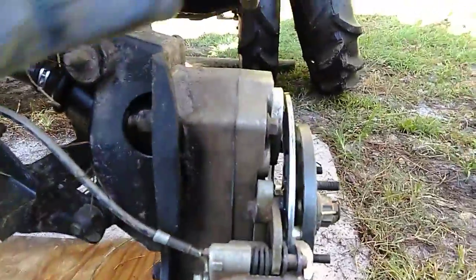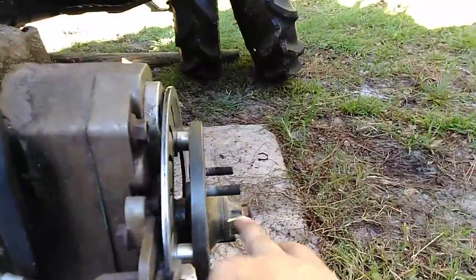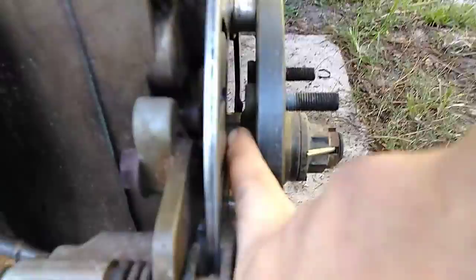The Gen 2 gives you a new front cover, it gives you a new hub, it gives you a bigger shaft. They even say in the Gen 2 ad, a bigger cotter pin. Oh, why would you need a bigger cotter pin? Maybe because they're designed wrong, the nuts loosen up. Also, you see that spacer down in there?